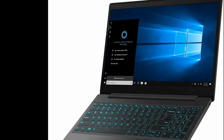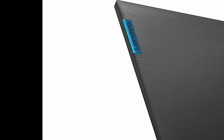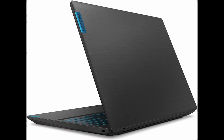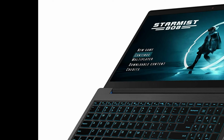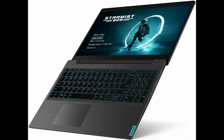Our measurements show that the L340 has a very good contrast ratio of 1528 to 1 and also a very good black value of 0.18 cd per square meter. Therefore, colors look well separated from each other and black tones are deep and rich. The gaming laptop from Lenovo is able to lead our test field with these values.